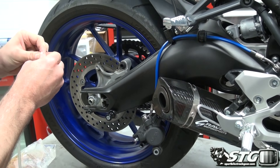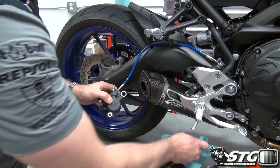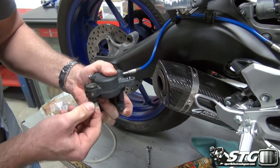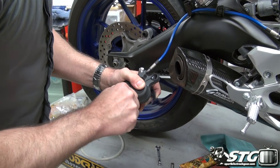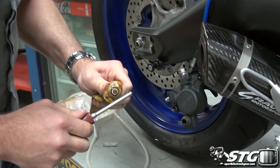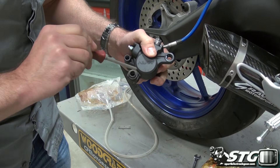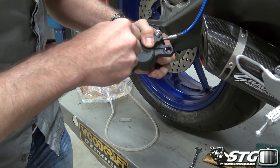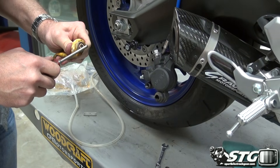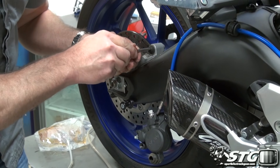We will use this again because when we're all done here we're going to bleed the brakes and change the fluid completely. Next step: there are two points that need to be lubricated — this is pretty important. What we want to do is slide the pin out and put a little silicone lube in there. I like to use an old Phillips screwdriver that I've modified the head of a little bit, because you want to get just a good thin coating all inside the bore. You don't need to overdo it — if you overdo it, it's just going to push out all over the place when you put it together. I'm going to do that on the other side as well.